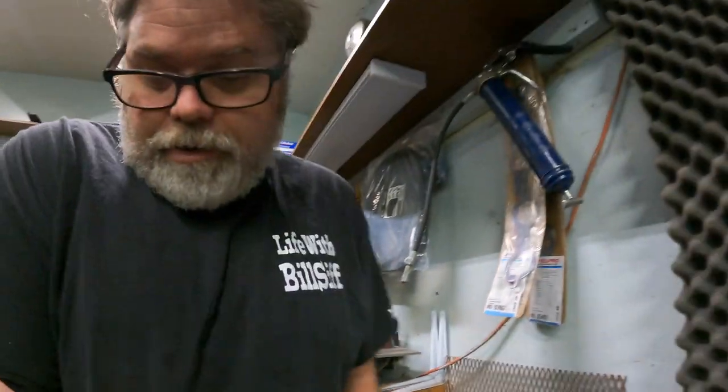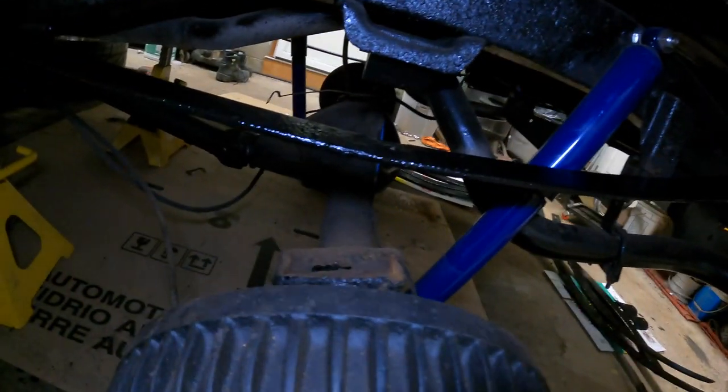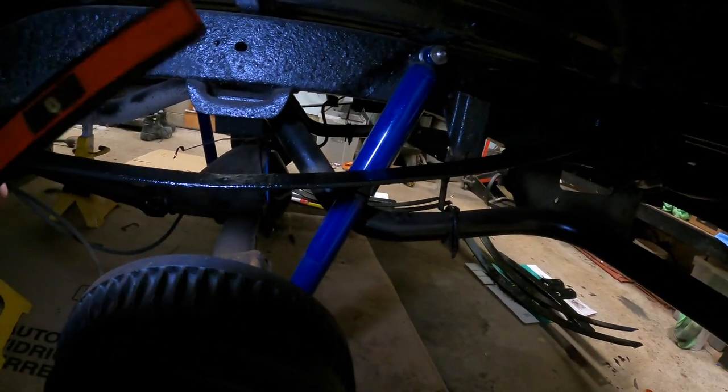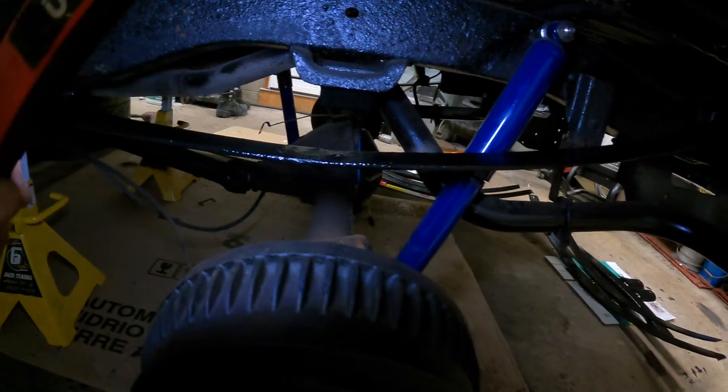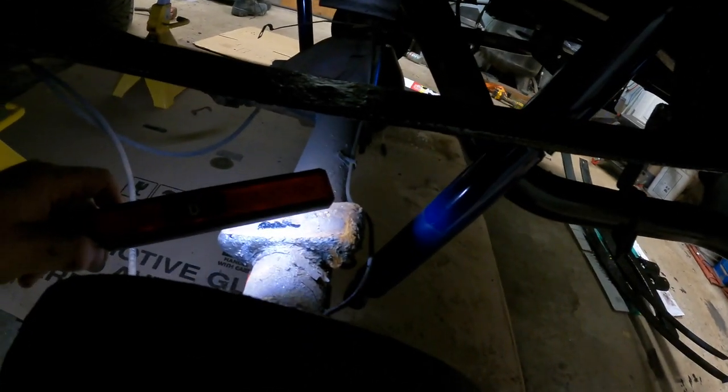If I could find my flashlight I'd be able to show you what's really going on here, but it seems to have disappeared. So I got the axle dropped off the leafs again because I like doing things multiple times. I left the main leaf on to do this job because I didn't feel like taking these bolts out over there — these leaves seem pretty good. So what I ended up doing is just taking them apart right in the truck. You put a C-clamp on here, take off the two doodads, then let the tension off of them. You unbolt the rear end.